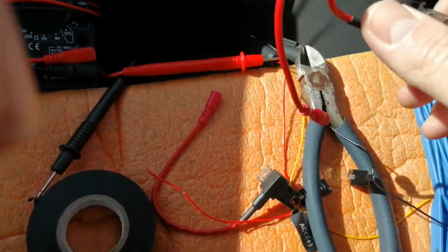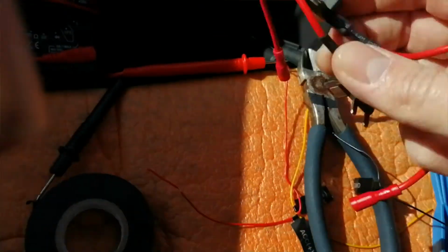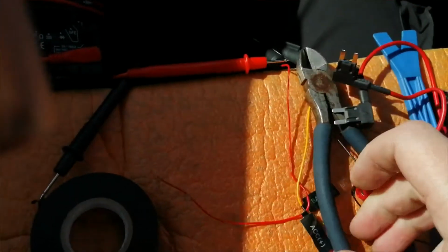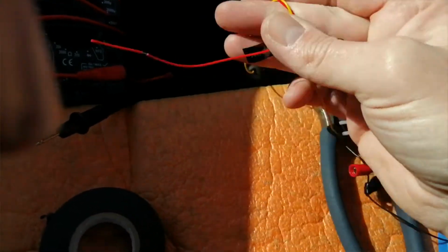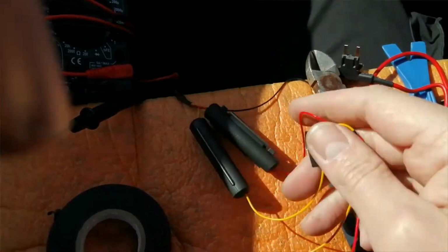Okay, now this particular camera has like a parking mode that's hardwired in, so we've got 2 fuse spurs, just there, look. Power cable to it is here, come here, sort of stuck, there we go. So we've got 2 powers, we've got a constant and we've got a switched, and we've got a black wire which is an earth somewhere as well, disappeared down into the yonder somewhere.